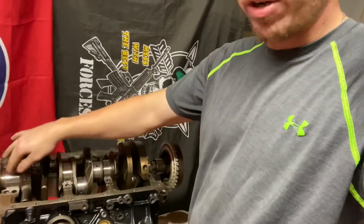So what we're gonna do from now, take this guy, I'm gonna go ahead and reapply the assembly lube. Now we can apply the assembly lube. I did it a little bit too early, I got ahead of myself. Got all excited, happy-go-lucky, got my plastic gauges, and I'm like, I gotta take this oil off of here. I wasn't supposed to do it yet, okay. Whatever happens, I've been doing it. So put the oil back on the main journals and on the caps, on the bearings, and then we're gonna put this one in.